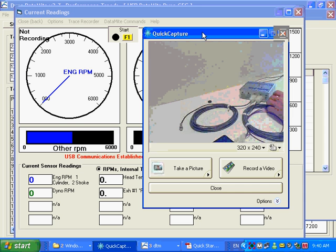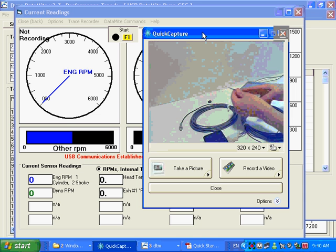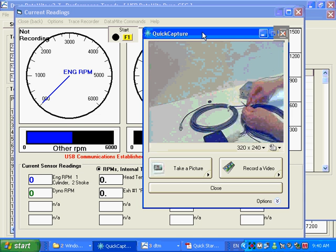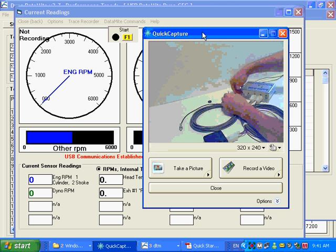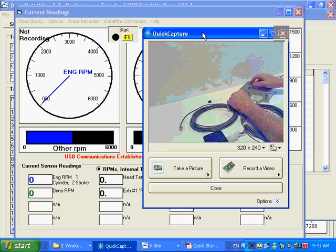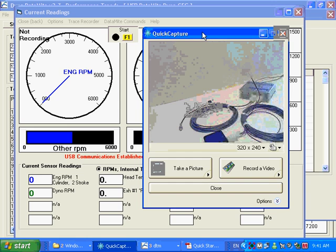Remember, you've got to go fairly fast or you will get no response. To check an inductive pickup and see if you're getting a signal, push a stick pin down through the shrink tube to reach the metal wire fibers of the purple wire. Then tap that stick pin against the upper left corner of the analog inputs, which has a 5-volt power supply. You can't just hold it — you have to tap it. You'll see a response on engine RPM, indicating the system is working. That's a couple of nice ways to troubleshoot RPM channels.